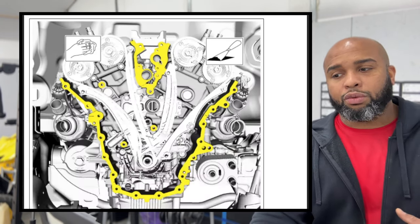But first, before we do that, we're gonna lubricate the inside of the crank seal and that little collar that goes inside of it. It says you need a specialty tool. I didn't have to use one. I got my pulley started on there because it is slightly beveled. And then I just tapped it a couple times with my hammer to get it on. A rubber mallet just really wouldn't do it. I got the OEM, the original bolt in there, turned it a couple, made sure it got a couple teeth in there, started, and then I just turned it and it just slowly pulled itself back into position. When I felt that it was getting a little tight, I did take it out and replace that bolt. I know you do not reuse this bolt, but I did take it out and replace that and I didn't have to do that. It goes into a three-part sequence.